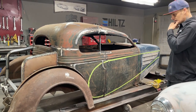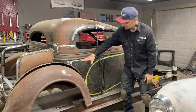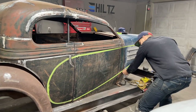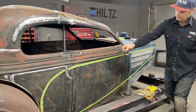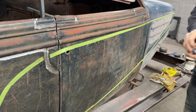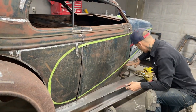I'm going to get Jolene to help me on this. I'll bang at the fender a little bit and do that sort of stuff. And then we're going to start putting this fender on and just tack it on and just start going from there. There's going to be some square tubing that's going to be welded along here, because the fender's rolling up on it. Means the fender's rolling up on the side. My plan is to weld square tubing on there so I can lay metal on there for the fender to come up.